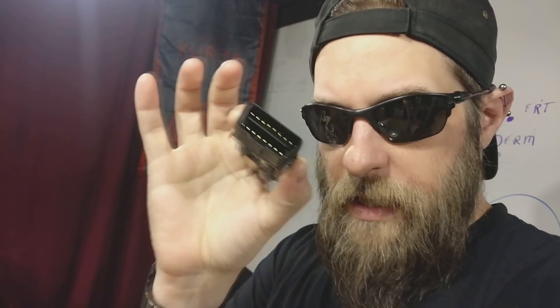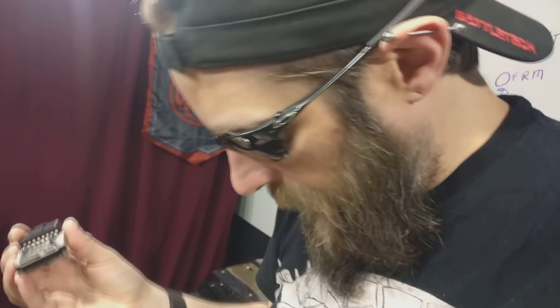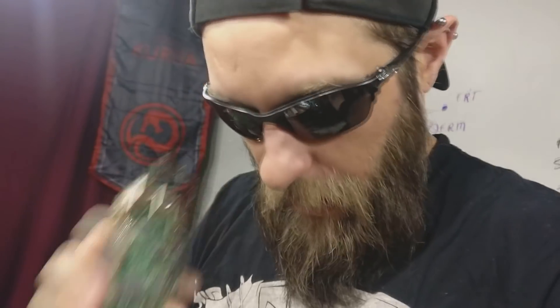This is the kind of internal component to all of this — this is a Macchina. It is an OBD2 connector and a breakout for basically the CAN bus, so you can get all sorts of data out of the CAN in the car. This little piece on top is their own open-source version of an Arduino breakout with Zigbee connectors on top, but it is not required. It's got a 26-pin breakout in the back — it acts like a breakout in the same way that the 40-pin GPIO is a breakout, except this is Arduino stuff.